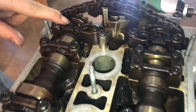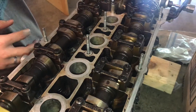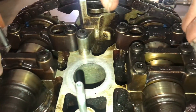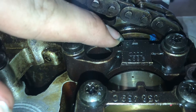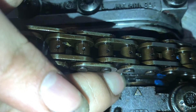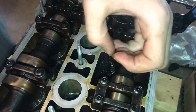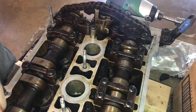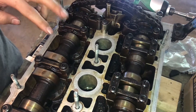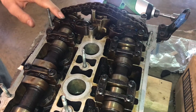When you tighten that down it's going to pull in a little bit, so I lined up these two gears with the timing marks as best I could, then added all of the cam holders to hold the camshafts in place. After tightening them down I can see this timing mark is pointing to one right there. Looking straight down you can see they're not aligned how they should be - this one should be over just a little more, centered. So I'm one tooth off on this one, but the other one is good. It's tricky to tell because when you take these off the two camshafts pull together due to the tensioner. So I'm going to take all these off again, move it over one tooth, and put them all back on.